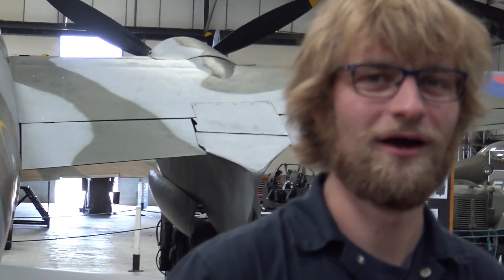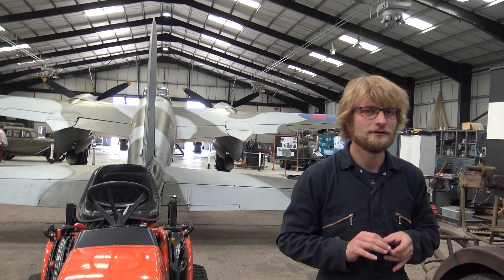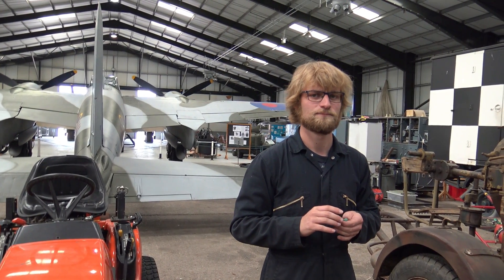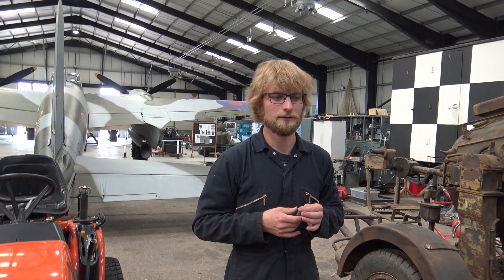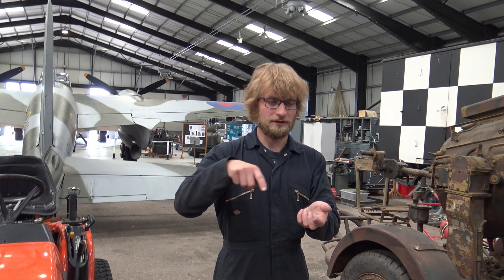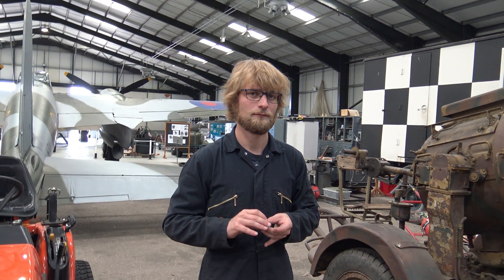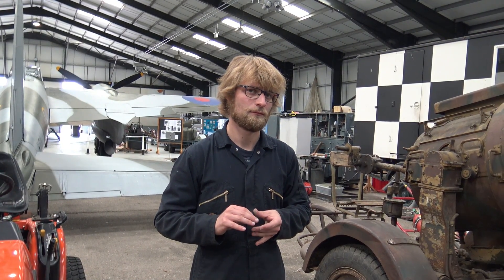When you switch one of the magnetos off you get a drop in power because you've got two sparks and they're seven degrees apart — your inlet is seven degrees before your exhaust — which they found was the optimum spacing. You get a slightly less even burn on one plug. Whether one plug is more powerful than the other I honestly don't know, but you do get more power with both sparks firing, and you get an equal drop if one of them is off.